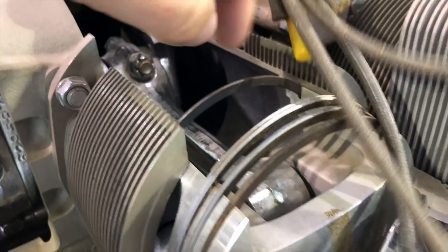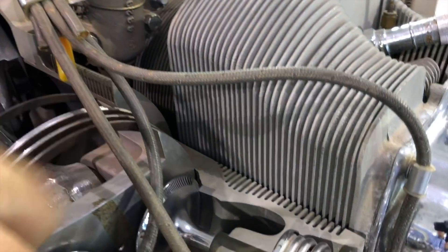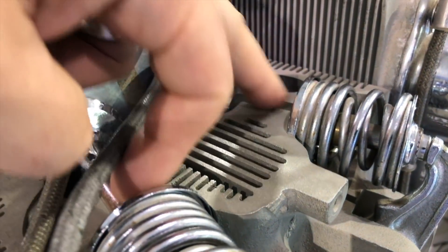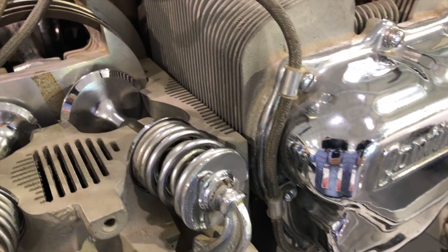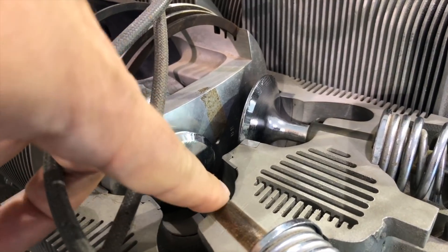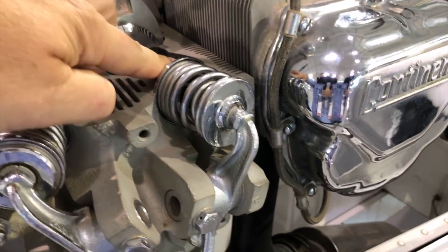Also a nice cutaway of the connecting rod, piston, and rings. You can see the barrel of the cylinder, the valves, and the valve guides right here. That's the most critical piece of this whole thing — very little or no lubrication and extremely high temperature. That's why it's so important to run reasonably lean with these engines so these things do not develop deposits, because there's really no way to clean them and they're exposed to extreme heat.